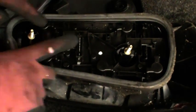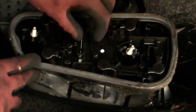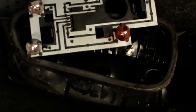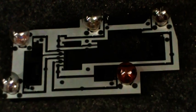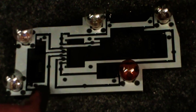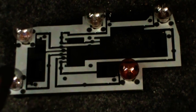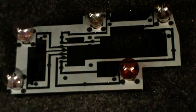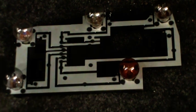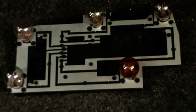To access the bulbs they live on this panel - simply just press these two tags here and here, and that will release the bulb panel from the actual lens assembly. We have effectively a printed circuit with a shared earth - so every single one of these bulbs will use a shared earth and then have its individual supply. You can see the orange indicator again, similar to what we saw at the front of the car, and then we have various other lights: fog lights, reverse lights, stop lights, tail lights, and so on.